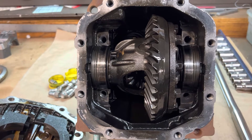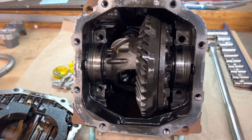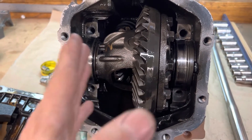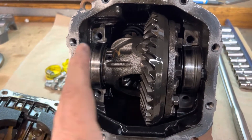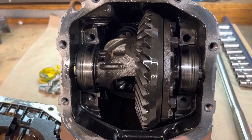This is the factory setup just opened up — there's probably maybe three to five thousand difference from the left to the right. We're going to be installing a 3.63 ring and pinion gear ratio, and that is going to dramatically move this ring gear when in position hard to the left. It's going to be a big shift.